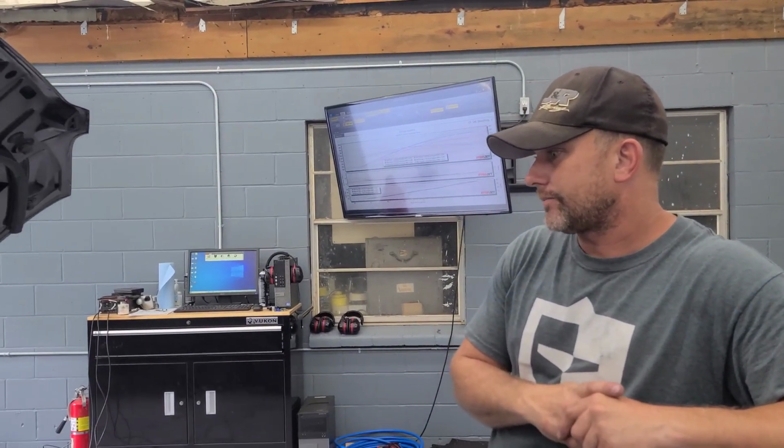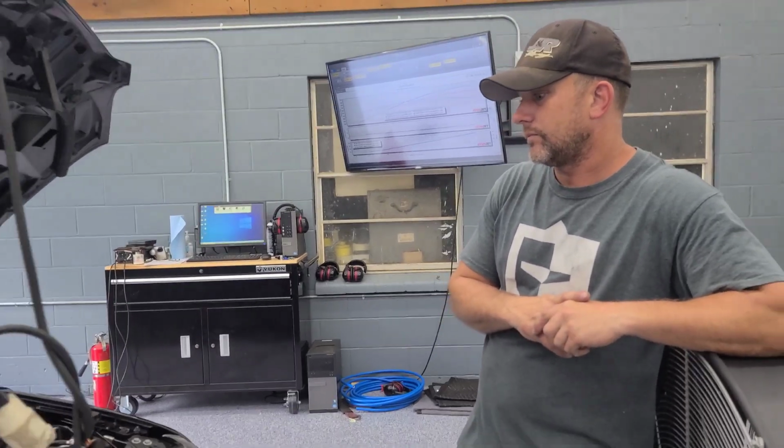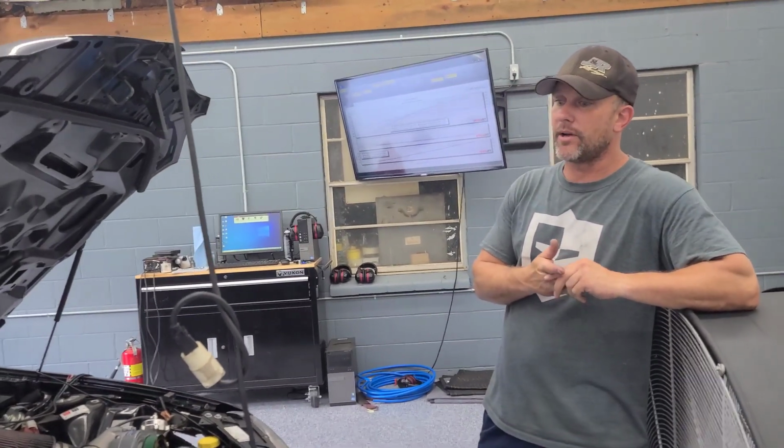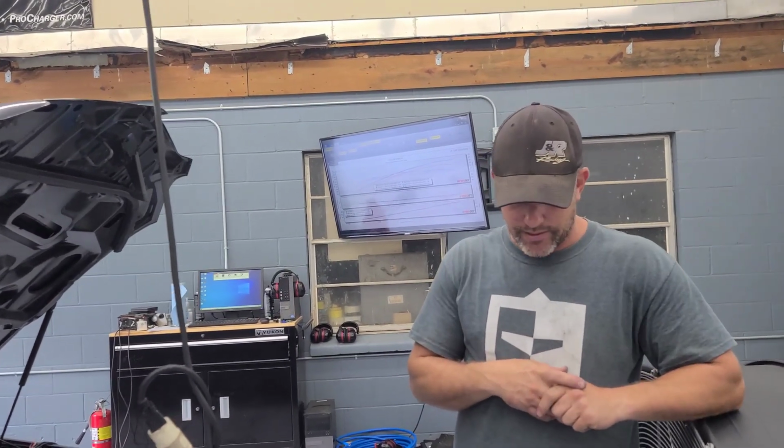Fix that. Now it drives great. I'll admit I've only driven it on the dyno, but I've driven a lot of cars on the dyno, and it releases like a stock one would. We put a Monster Twin, an SC series, the higher grip one. They use a stock pressure plate that's modified for the twin disc, so it has a stock pressure plate feel. The pedal feels great.